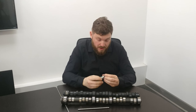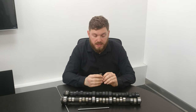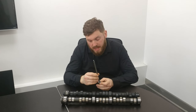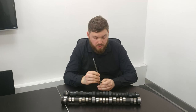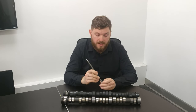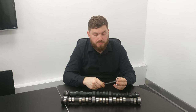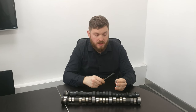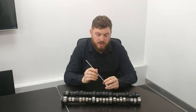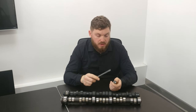It still works fine until it goes so far through the tappet that it hits the inside and oil leaks out. These tappets are hydraulic self-leveling tappets. The height of the valve inside is determined by the oil pressure. Put these in dry — when dry you can push against its own spring pressure and it'll be loose — so when you first fire the car up you'll get a rattle as oil is forced into the tappets and they find their height. If you prime them first before installing them they'll be too high, risking bending a push rod. You must always fit a tappet dry and let it self-prime.